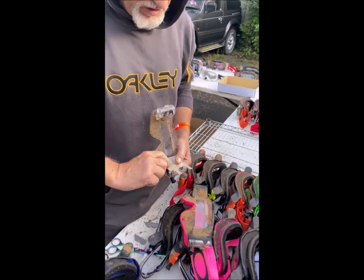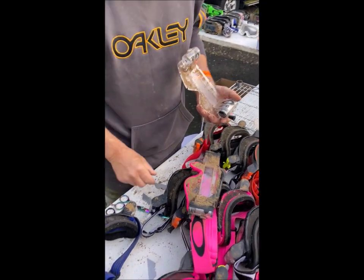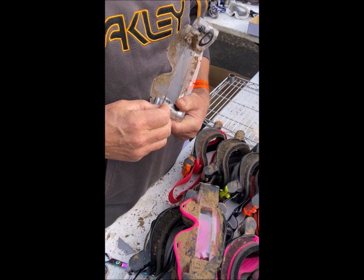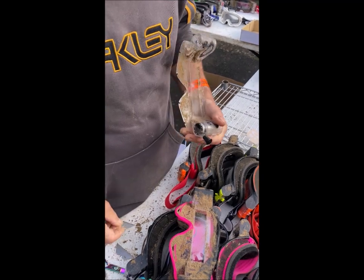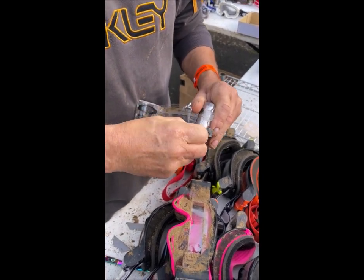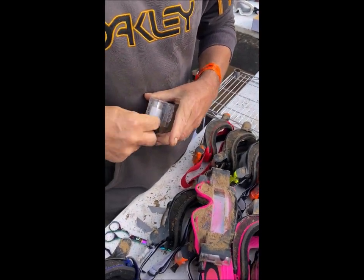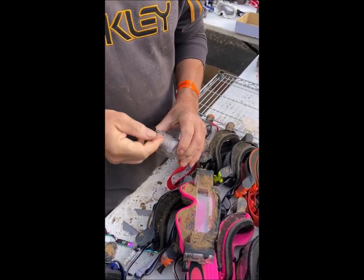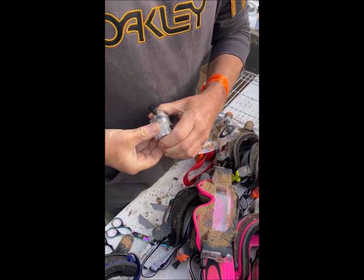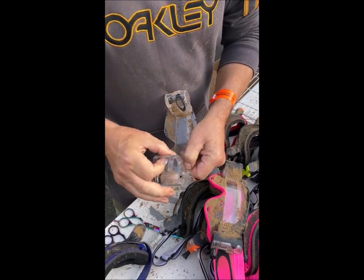You need to cut the motor protection off so you can open the doors. Stanley blade — run it round the joint a couple of times and it will peel off. Then just peel the two tags behind the door. Push down on the tag and push forward. Thumb on the mud strip to stop it coming off, then door off. Put that in the wash.